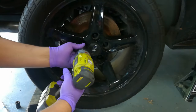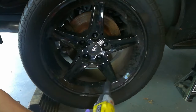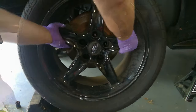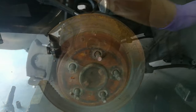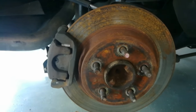With my Mustang sitting on jack stands, I'm going to go ahead and remove all the lug nuts from the wheels. Once your wheels are removed, you want to make sure you're not making the rookie mistake — go inside and release the parking brake on this vehicle.